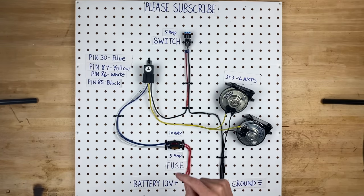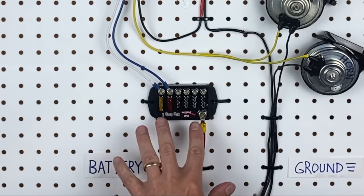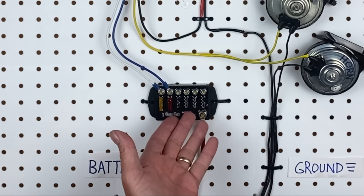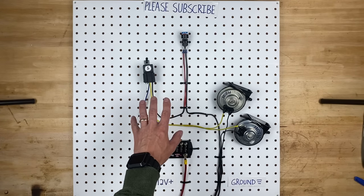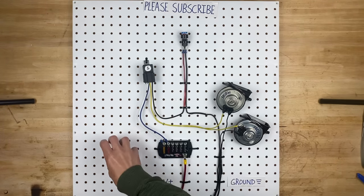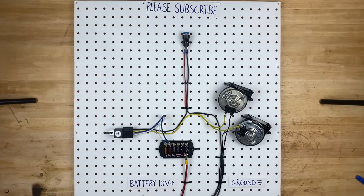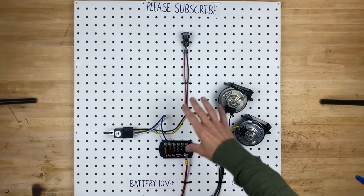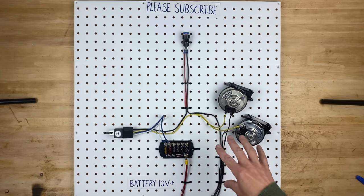So now let's upgrade the fuse box. You can see I've swapped out the individual fuses for a fuse block. This one's made by Leash Electronics, it's got spots for six fuses, and it has one big wire coming in and allows for six wires coming out. It's a pretty cool little inexpensive product and I'm not sponsored by them, but I like it. With the fuse box in place, I want to move the relay over here because I'm going to have a whole stack of them, and I think it would be better to have a distribution block for power and ground so I can connect all the wires a little easier.